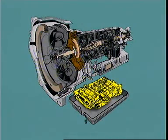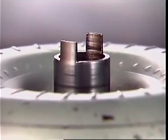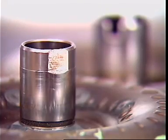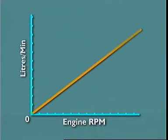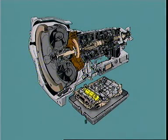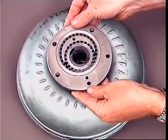The hydraulic control system requires a continuous supply of fluid under pressure, normally provided by a fixed displacement pump. It is driven by the torque converter when the engine is running. The pump driving member is engaged by tangs on the converter spout, or machined flats, or by slots. Pump output always exceeds normal operating demands, so pressures are controlled by regulating valves. Excess fluid returns to the pump inlet or is dumped into the oil pan, where it can reach the pump intake strainer. Crescent-type pumps are commonly used in automatic transmissions.